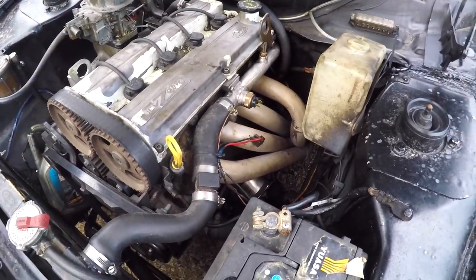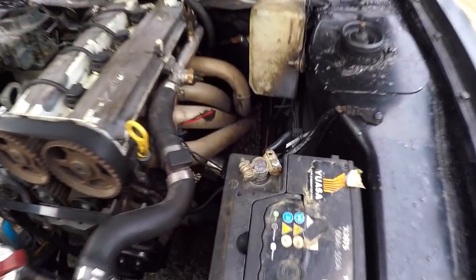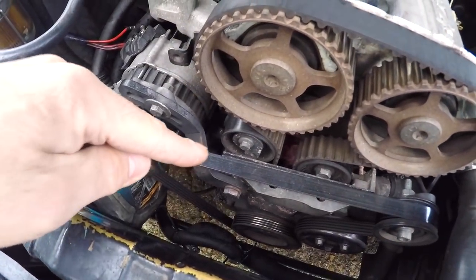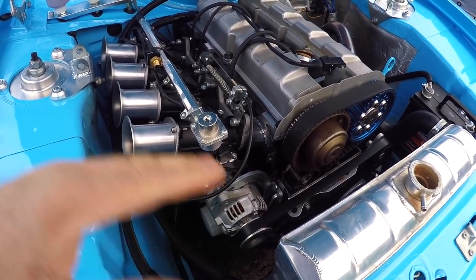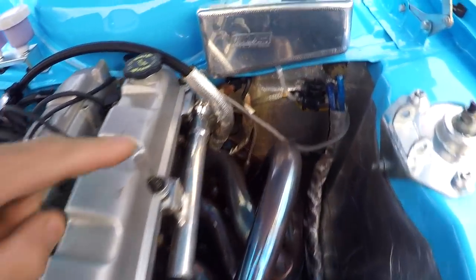On Maud I've actually had to cut out the cross member. I've also had to put spacers between the cross member and the chassis to bring everything down, and then space the engine up using washers between the mount and the cross member to give enough clearance between the sump and the steering rack. On Ester's setup I didn't need to cut the cross member, but I did put spacers between the cross member and the chassis to stop the water rail hitting on the lip. According to the internet no one else ever has problems with Neil Dunn sumps, but loads of people have been in touch to tell me they've had problems with them. He likes to threaten court action for going public, which is why it's hard to find any evidence online. Personally I wouldn't buy anything from him again.